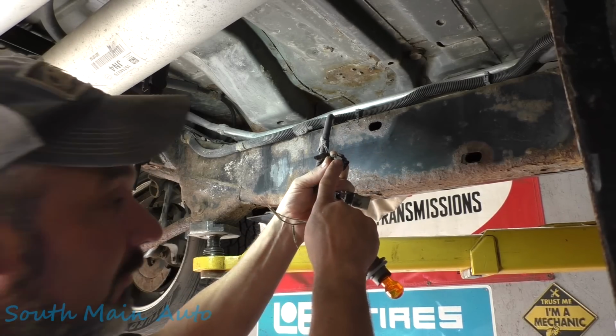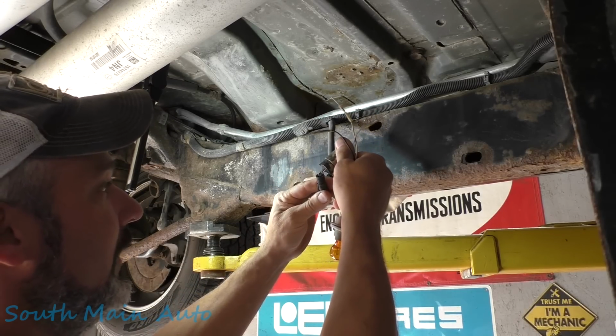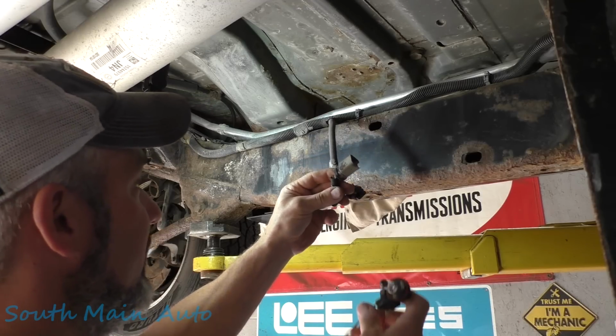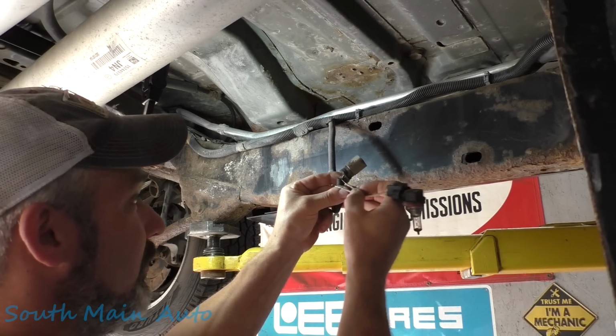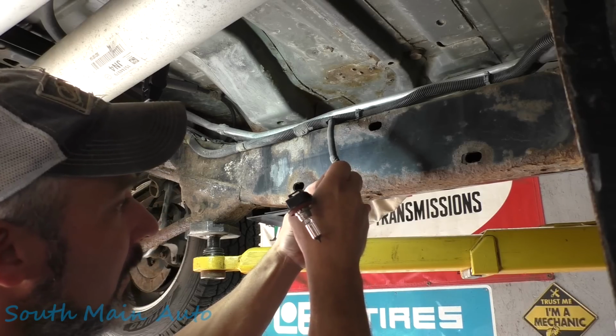We've got the connector here. This is the connector for the fuel tank pressure sensor. We're not concerned with that. This is the one we're concerned with, and whether or not it can carry enough amperage to make the pump run. It was the only test we couldn't do last time. So we have our gray wire and our black. Our gray is going to be our pump power.